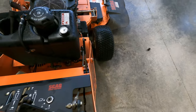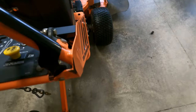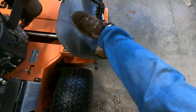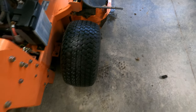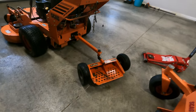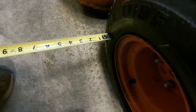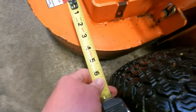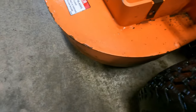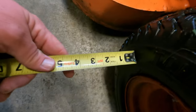If I'm standing on here — on the sulky — I don't think it's enough difference to hurt anything, to be honest. And it still surpasses the cut edge — you've still got plenty of room. See how far it sticks out past the deck? Let's go to the ruler. It's hard to tell, but this tire and the guard have about an inch difference, so the tire is still sticking out about an inch past the guard.